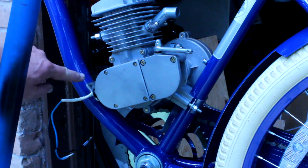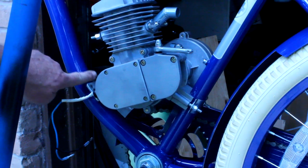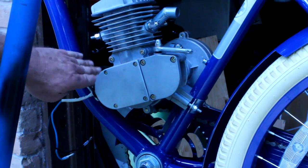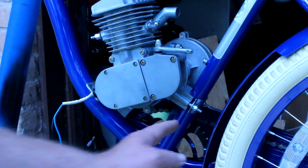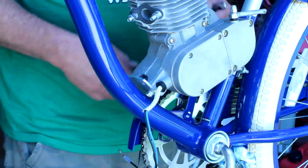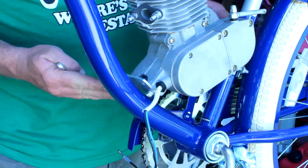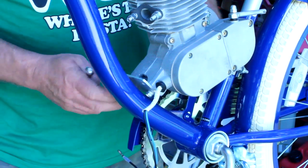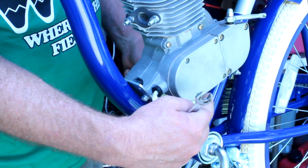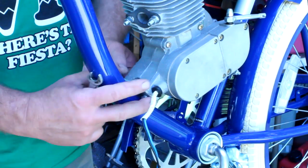I went ahead and flipped the plate around to have the mounting holes on top so the plate mounts firmly against the down tube. You don't want just a part of the plate digging in — that puts too much stress in one area. You want the mounting plate firmly against the down tube and the rear mounting plate fitted firmly as well. I still have a little gap, which means I need to move the motor down some. I loosened the rear bracket since it had drawn up, and I'll drop the motor down then re-tighten the rear bracket.